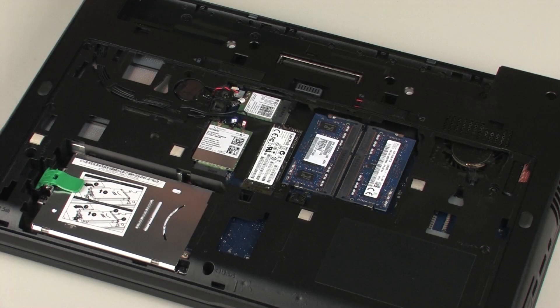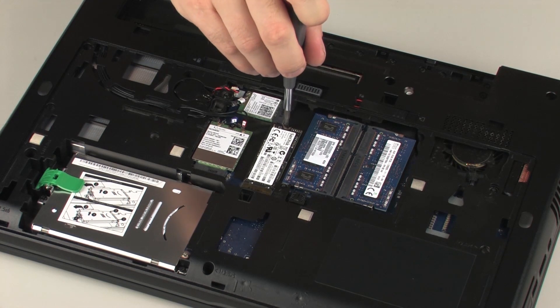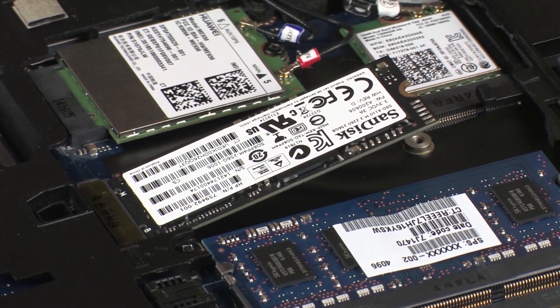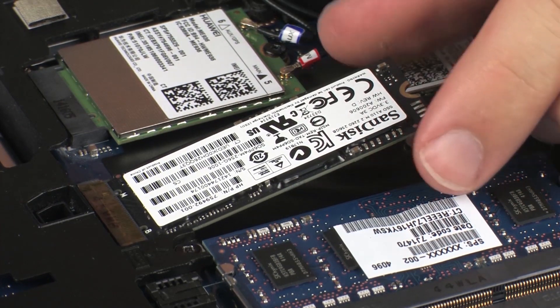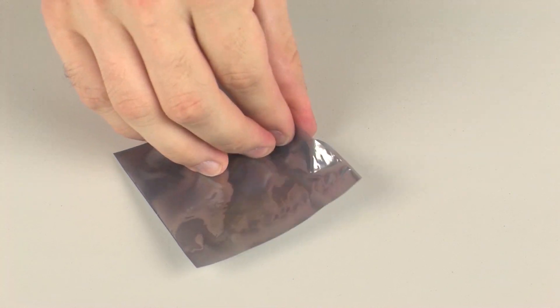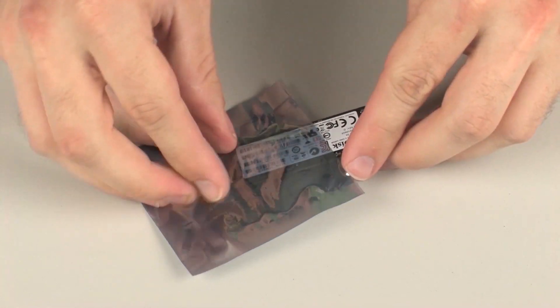Removal. Remove the thin 3 mm P1 Phillips-head screw that secures the solid-state drive to the system board and allow it to release to the spring tension position. Grasp the solid-state drive by the edges and pull gently to remove it. Place the solid-state drive in a static-dissipative bag.